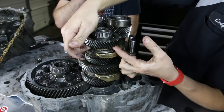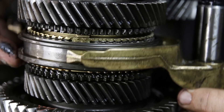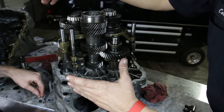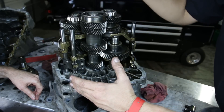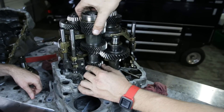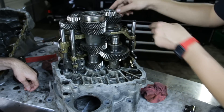Inside of here, it's very difficult to see, but we have our synchronizers. The way these gears engage is as you're moving the shifter forward and back, that's moving one of these down or up to pick which gear you're engaging. We've rotated the transmission around to get it a little bit easier to see the forks and the engagement from our shifter shaft assembly. The next stage back towards the engine is our input shaft, which drops down through and engages with the clutch on the car — this shaft will always be turning any time the clutch is engaged. When you select the gear on either one of your output shafts, you're transferring power through the synchronizers, through that gear, into this shaft, and ultimately into the differential.